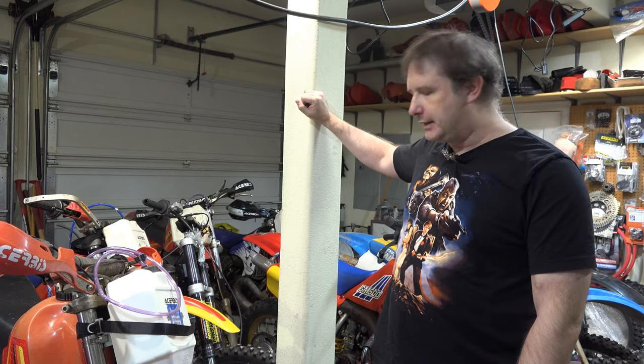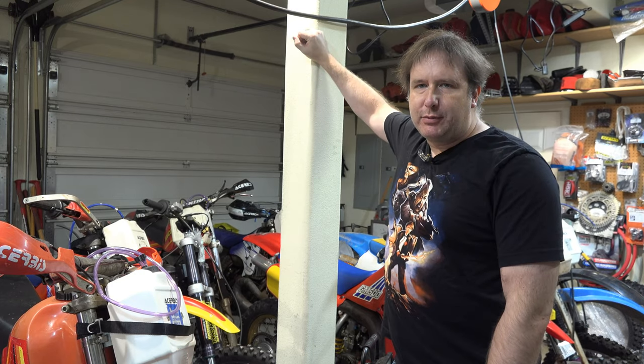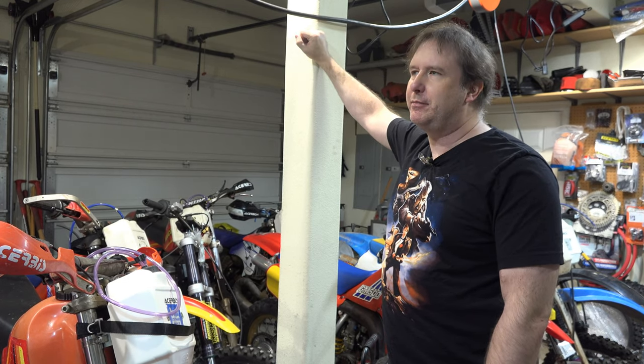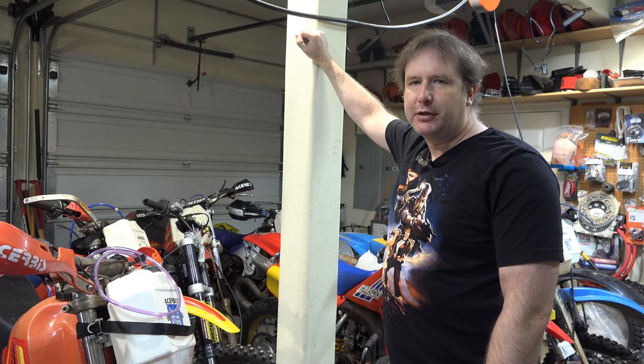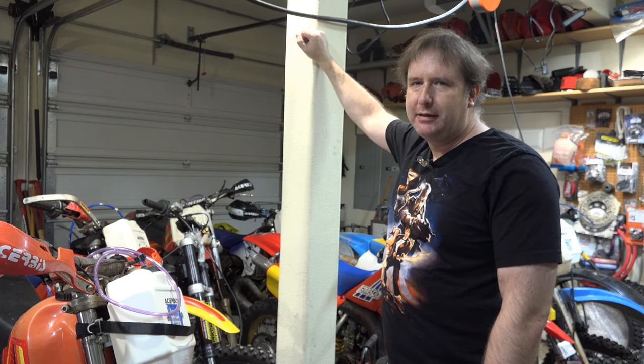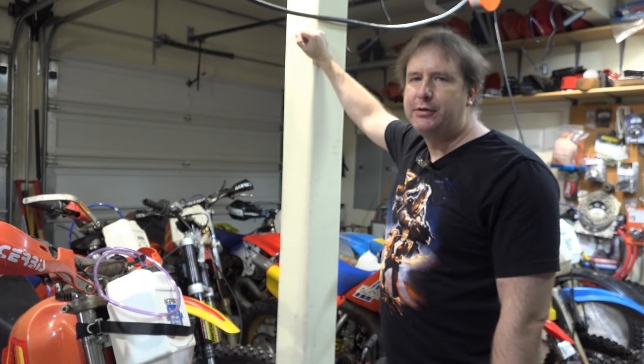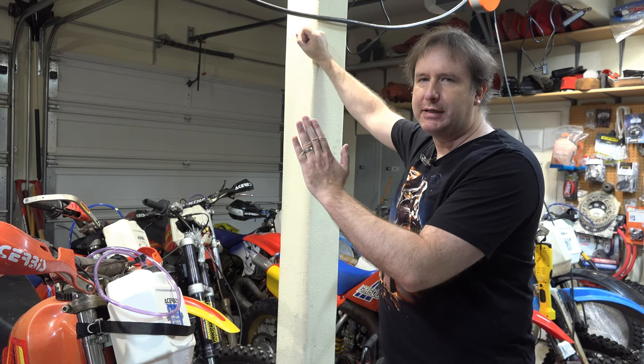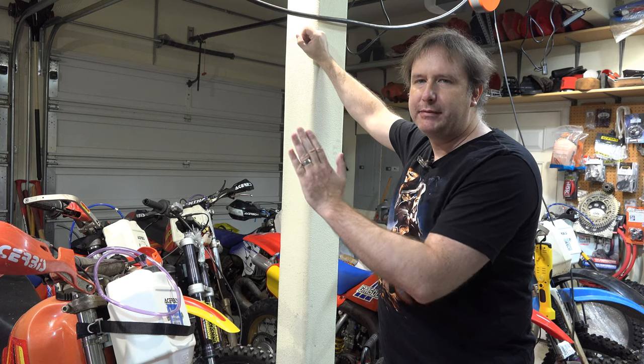The other thing was that if you remember, I was also working on a Zabel 700, and the problem I ran into was I needed some help with the mounting for the carburetor, because the carburetor goes right into the rear shock. A lot of people for the newer engines, I think they do use the Husaberg frames because the shock is mounted further to the left-hand side in the frame. So the carb would come out this way, whereas now the shock is here, so it pushes the carb like this into the frame. Even with the Maico 700, the carb just barely fits around it.